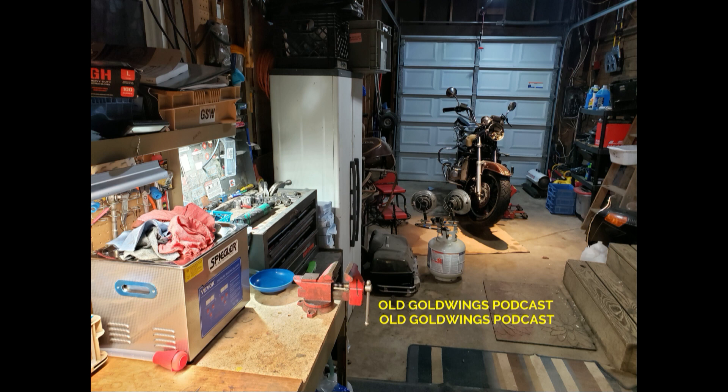Original Honda jets are very robust. I've had them come in completely plugged up with nasty old pieces of rubber parts and debris that collected over the years through the fuel lines. When I get those carbs back to people, I always tell them to get new fuel lines and a new fuel filter first thing — replace those because they're really easy to get to when the carbs are already out.